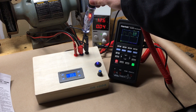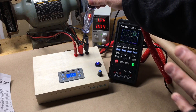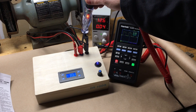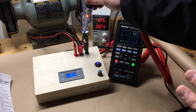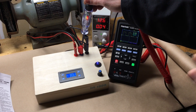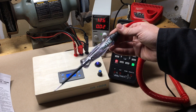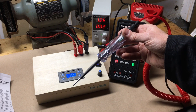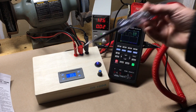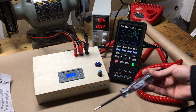The beauty of this is no swapping the alligator clip between power and ground — you actually have the capacity to see both. That's why I wanted this. For example, a reversible motor on a climate control system may toggle one direction and then the other. Simply by keeping the probe on there you'd see the red for power and then the green as the polarity toggles on the motor. There are many applications on a vehicle that do exactly that. So far so good — it seems functional out of the box, which you can't always say about things off the slow boat from China.